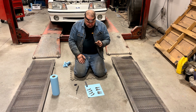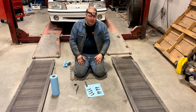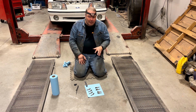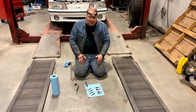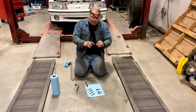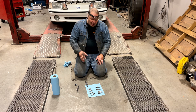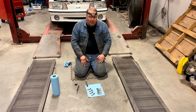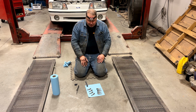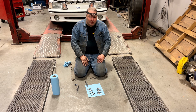Here's one of the problems with platinum plugs: if something goes terribly wrong inside the motor — like it runs lean, or maybe you've got a nitrous car where the fuel jet doesn't work or the nitrous sticks on — the plugs are quite resistant to failure. So what happens is the car will start burning whatever metallic thing is easiest to burn. With plugs like this, it's going to start burning up the pistons. With regular copper core plugs, it'll burn the ground strap off and the plug will stop firing, shutting that cylinder down, giving you a little more chance of getting away with something that's wrong. So we're going to put NGK copper core plugs in here — TR5 or UR5 — just slightly colder than the dead stock heat range. We'll gap them at 45, where they should be, and hopefully we'll get a performance improvement just from that.